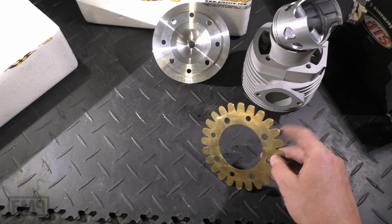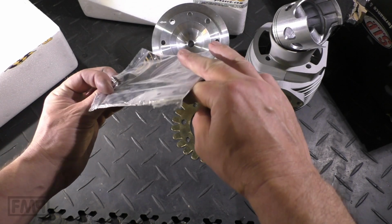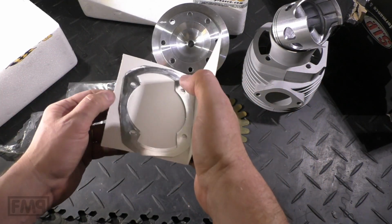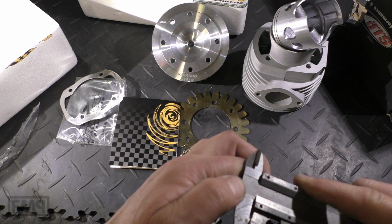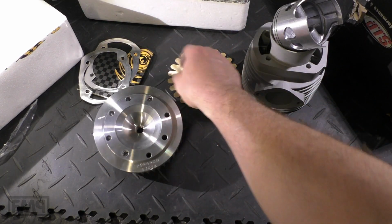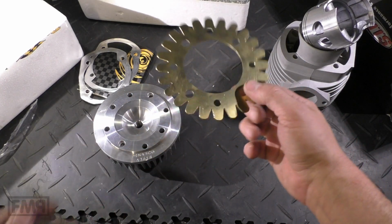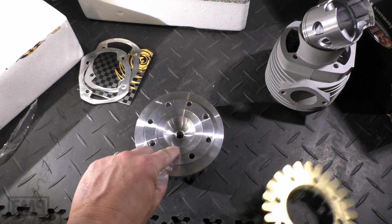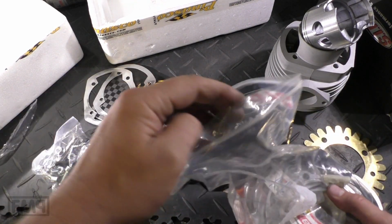As the Malossi Sport is coming, the MRP is coming. Okay, but it looks important, doesn't it? What's this? Manual. No, foot gaskets, nice. Both the same. 0.25, twice. So, what is it with this head gasket? You make the cooling ribs very tiny, too small, very small. But then you just take this voodoo head gasket and everything will be fine. Compared to the MRP head, wait, got it here, and even the standard Malossi head, there could also be some cooling ribs at the bottom.